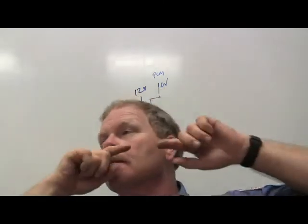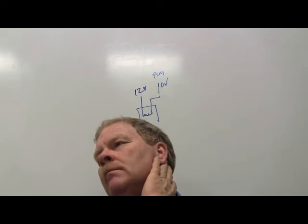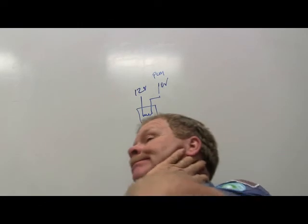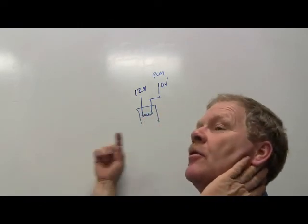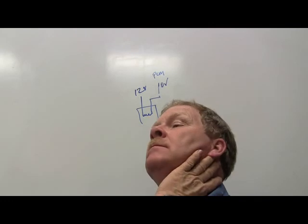You've got 2 of the same wires coming out to a connector, and the connector leads to the oxygen sensor. You're not going to read 12 volts on both of those same wires at the connector, only if it's plugged in, because it's going through the element in the sensor and coming back. So it's coming from the 12 volts, and the PCM is reading the 12 volts.